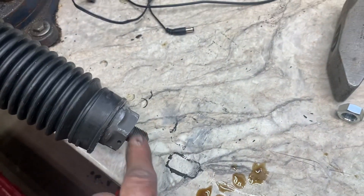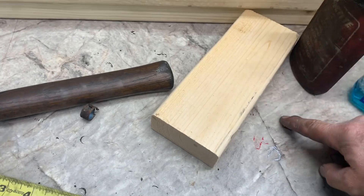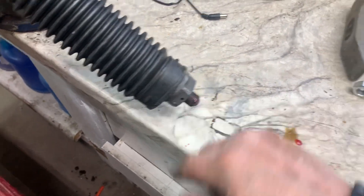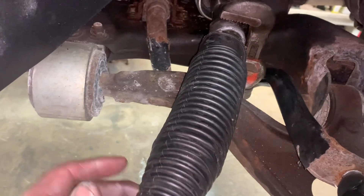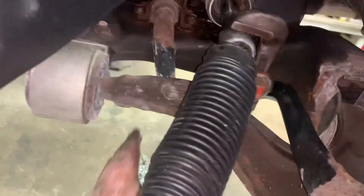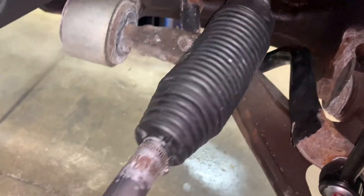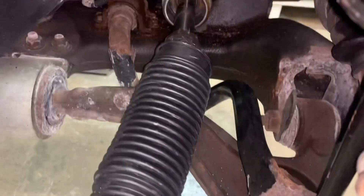Tighten your jam nut — we're ready to go together. Rub a little bit of Loctite on there; just a little bit, not a lot. Now start it and get it threaded on there, then tighten it up. I've got a pipe wrench on there. Just tighten it up — you don't need to bear down a crap load because you don't want to damage your rack. You've got Loctite on it. Make sure when you try turning it that you're not unthreading it, because I've done alignments where I thought I was adjusting the toe and I was actually unthreading it because people don't tighten them up and don't put Loctite on them.